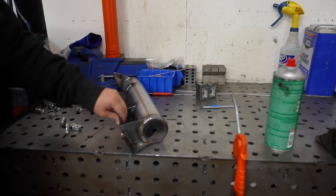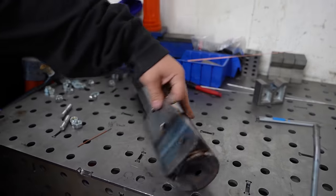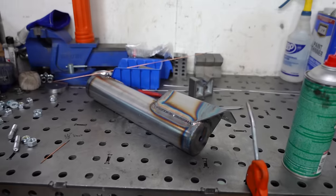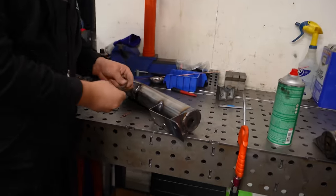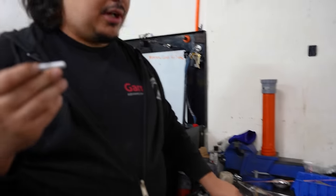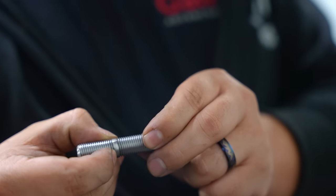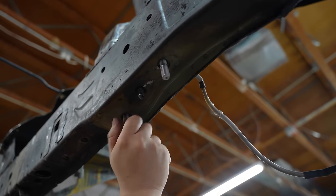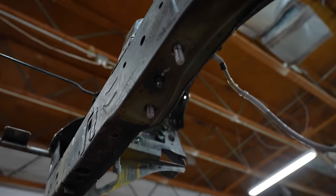The little torpedo tube things are all welded up. I need to cut the outside pieces to be able to put the bushings and lower control arm in there. Right now I'm mainly focused on getting the actual subframe built with the engine and steering rack in there, because on Thursday someone's coming over to get the car scanned. One of the hardest parts about building race cars is people have things close to what you need but not exactly. We had these studs but they were just straight thread, so I ended up putting a small weld on there to make it my own stud. And this will stop right there — it is three quarters of an inch out, which is exactly what I need.